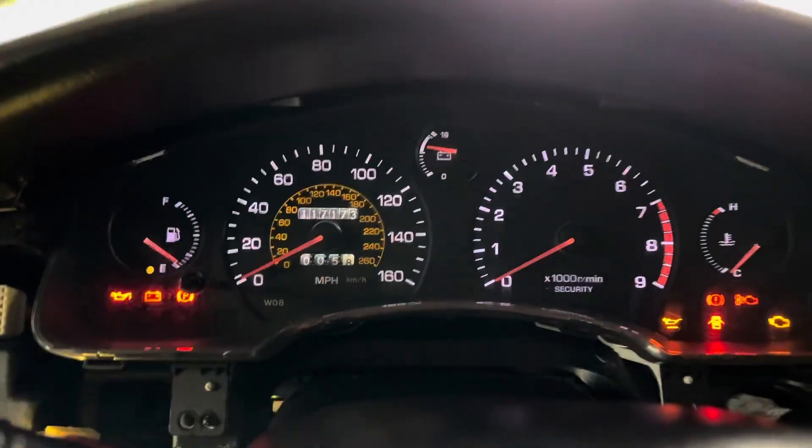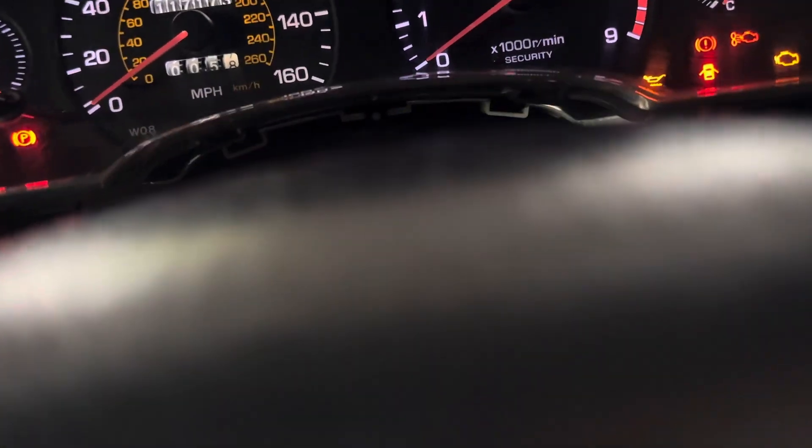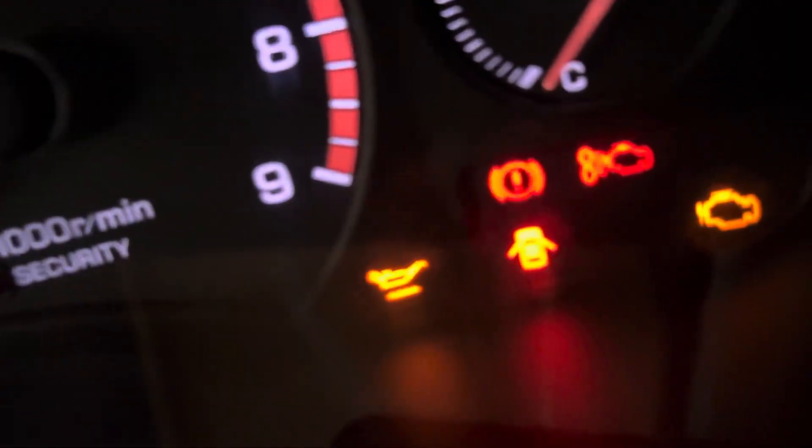After that there's another clip up here that you just pry off from one side and it comes off — it's all just clips. Then you finally have access to the speedometer cluster and it just pops right out. On the back there's a bunch of ribbon cables. I don't want to unplug them in case it messes something up. You just gotta hold it with one finger or have it lean under the steering wheel — it kind of hangs there and you can adjust it.